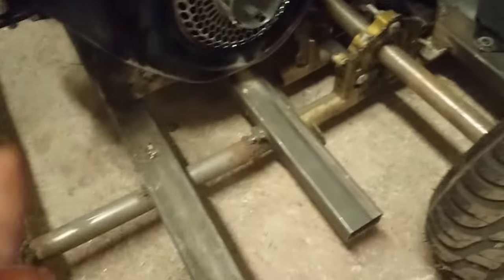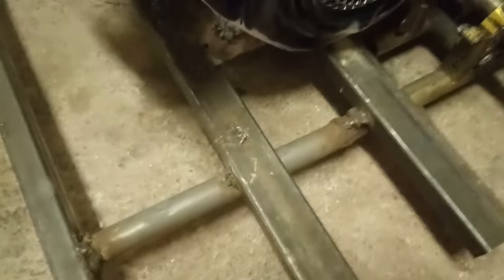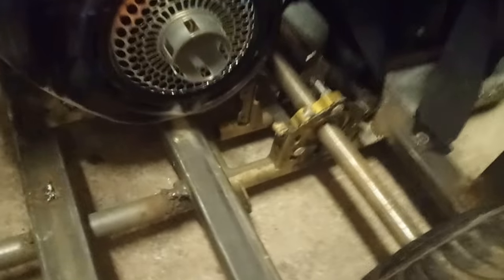One of the problems with mounting the engine here is that when I accelerate, there are a lot of vibrations, which is kind of scary. The downside is it actually bends the frame down — and bending it down stretches the chain, so I can't have that. I'm going to need to add something from here to here to reinforce it — probably another bit of box section on both sides, which should help with the vibrations and keep the engine nice and sturdy.